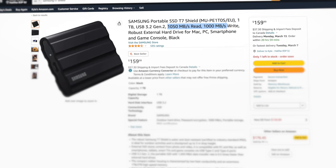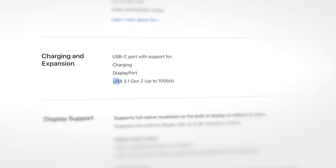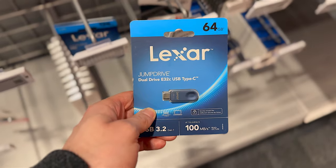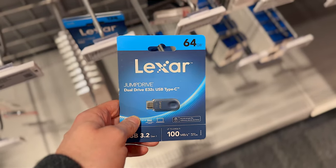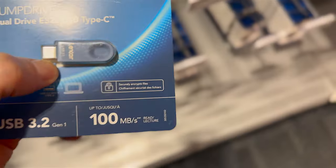Usually if you take a look at a product page for these external drives, they're pretty upfront in telling you what the drive transfer speed is, and if that aligns with the speed on your port. You can also look at the USB version supported, but unless you have a solid understanding of how that all works, it can be kind of confusing. USB versioning is an absolute mess and sometimes if you're just looking at the version, it can be misleading. You can see on this drive here it says USB 3.2 Gen 1, which used to be USB 3.1 Gen 1, which used to be USB 3.0. That protocol is supposed to be good for up to five gigabits per second, but if you look on the packaging it says it runs up to 100 megabytes, which is roughly 800 megabits — about one fifth of that speed.